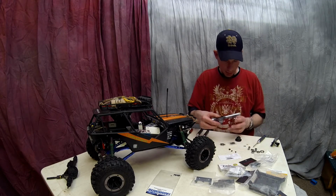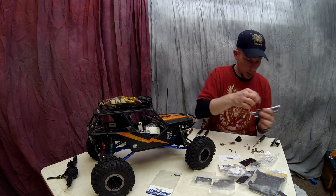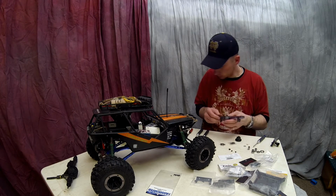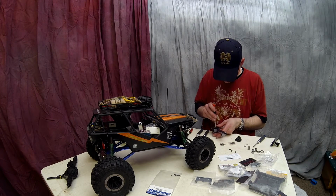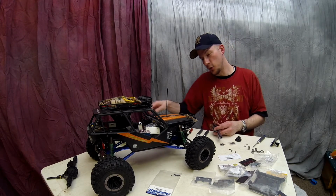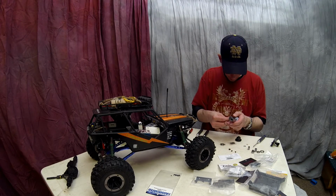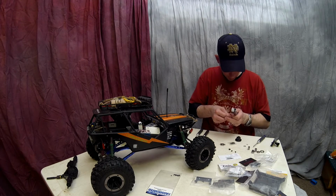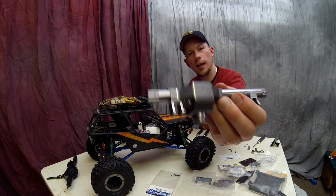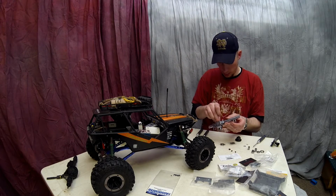Got that. Okay, and then in the housing, we've got to press in our one bearing down in the base. Same hex that you used to undo your wheel nuts with. Works slick for pushing those down in there. Cool. See? Bearing inside and your bearing on the outside. Pretty slick, right? And then in goes our pinion.